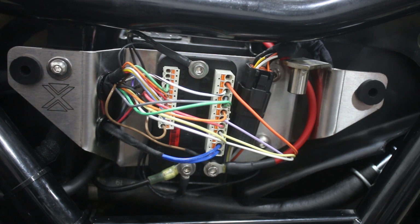So start with the actual switching on the power to the bike. Now, obviously in the original Harley wiring, the ignition switch itself, a lot of power runs through that. You've got a 12 volt input going through it. You've got an accessory and an ignition takeoff and switch within that key switch. And you've got 12 volt power that's supplying those accessories and some of the 12 volt things on the ignition circuit that actually run through that key switch.